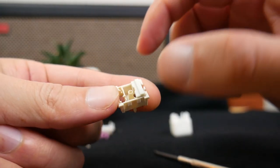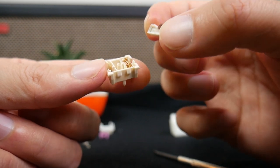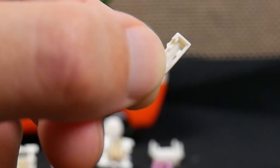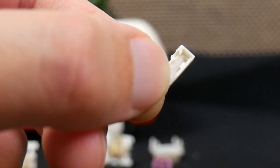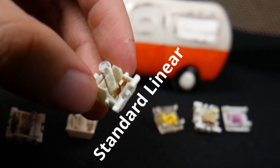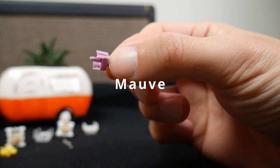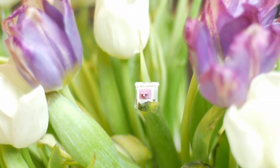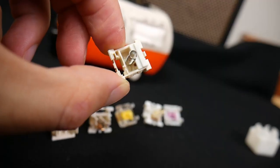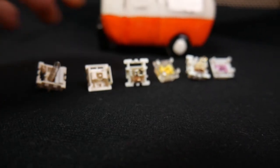Opening up the mechanical housing, the nub is tiny, which makes it pretty hard to put back together. There's a little reservoir filled with lube, and this is how the switch lubricates — on each down press, the little nub dips into the reservoir, re-lubing itself. Pretty clever, but very hard to put back together. When I lube my switches, I normally lube the sides of the stem and the spring. In contrast, these other linear switches — the Mojave — came pre-lubed with lube all around the stem. But to be direct, I really didn't care or notice. Perhaps it was the extra resistance or the extra mechanical step, or both, that make this absolutely a superior experience for both typing and gaming.